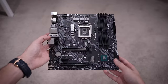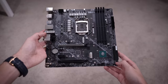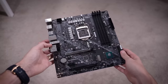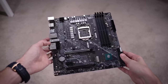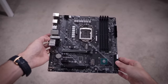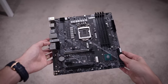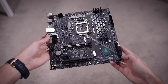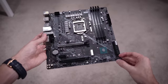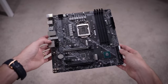I would tend to focus some of my time on the BIOS chip, which I think is down here. But you know, you really would be spending quite a bit of time repairing this. I'm not sure how expensive this board is — you might save yourself a hundred bucks, but you've got to think about your time as well. And then you've got to hunt down that particular BIOS chip. There are some tools that'll let you just jump onto this chip and flash it — might try to invest in something like that to see if we can salvage this board in the future.